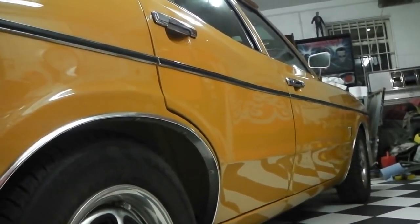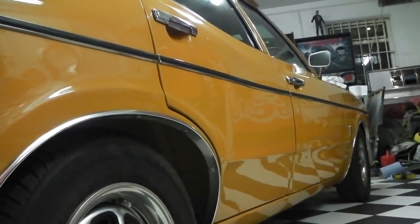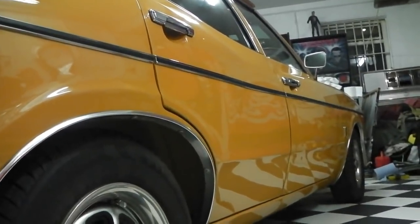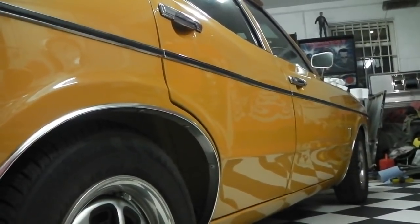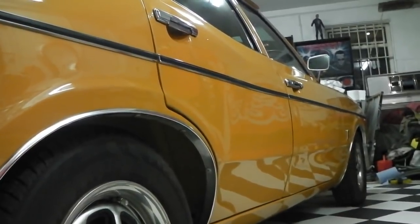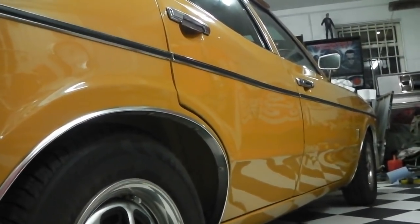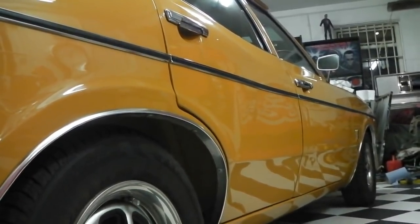What I did, I just went over with G3, a very fine cutting compound, won't do any harm. And then just getting it so it felt a bit more glassy. The car's been buffed once, but I think there's no harm in doing another mop on it. Anyway, we've hand buffed each panel with a little bit of G3. Then one of the Meguiar's waxes, then on top of that the quick wax, and then another polish down this side. We then check all the under arches are clean and desalted.